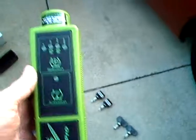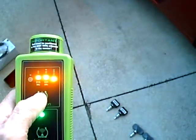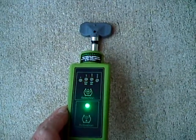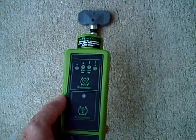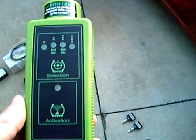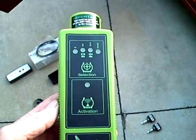What you can do with your tips or KTI PST is push the select button and continue to push and release it until you get all four lights illuminated, which means it's going to transmit with a continuous wave. When you interrogate a sensor it will trigger it almost immediately. Make sure the tool knows what type of protocol transmission to use, then put the car in learn mode. The next time you use the activation button it will use that continuous wave transmission and trigger your other sensors almost immediately. Try that to avoid the learn mode timing out on you.